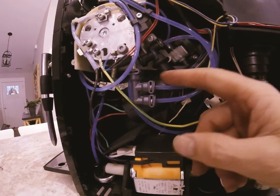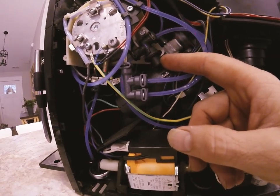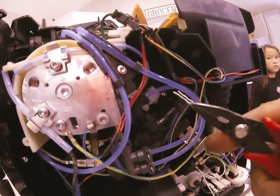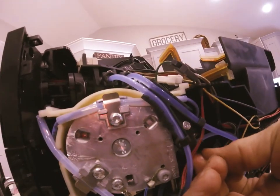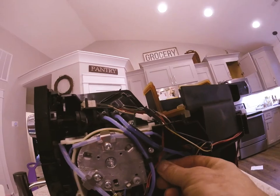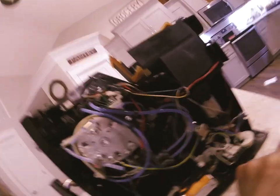This is probably the second most common cause of leaks in this coffee maker. These quite often need to be replaced, so if you see water marks or white marks on the tip of this, that means it has been leaking. Very simple to fix — you just grab onto these little cotter pin type clips with a pair of pliers, pull out, and it's unplugged. You can pull the hose out. To replace this piece, pull that clip, pull the one screw out, remove it, put the new one in, and put the new clips back on. Quick and easy fix.